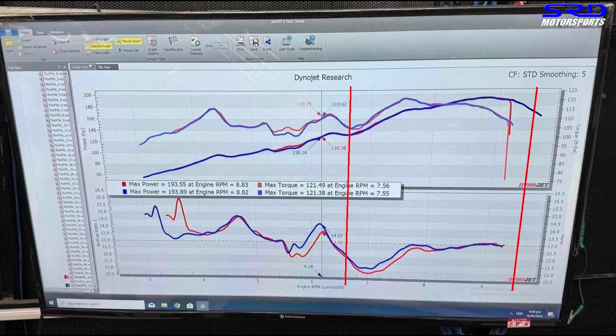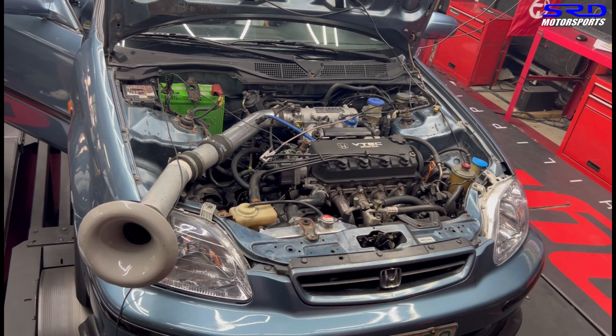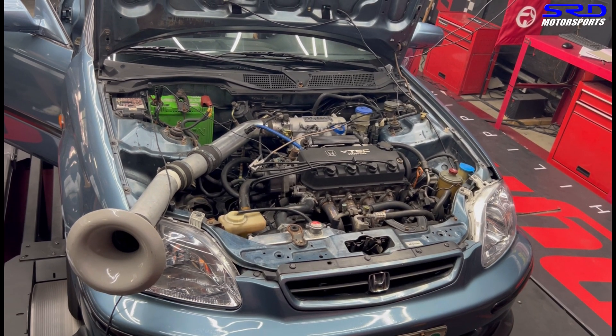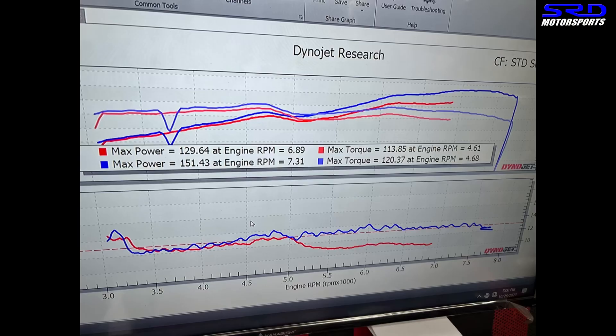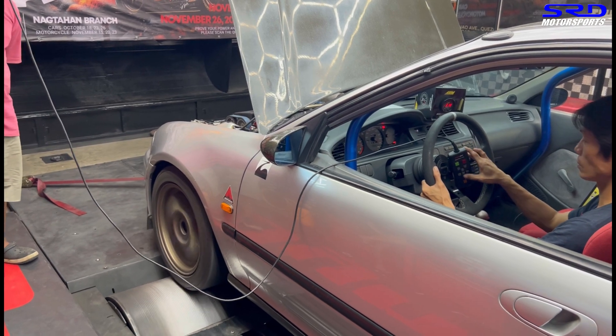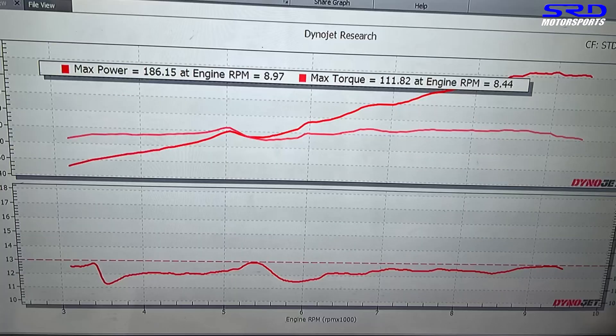Here's the graph once again — that's a good engine right there, and that's just a B16. We've dynoed B series a long time ago. As you can see, it's easy to figure out whether you need a third gear or a 4.7 or 4.9 final drive once you have a dyno. That's Joseph Stone of Honda Lab — look at the graph. Even after 9,500 RPM the power is still not going down, so this engine revs really well. This could actually use the 4.7 better than the 4.4.